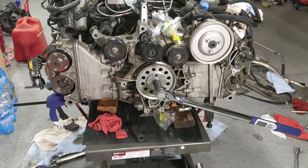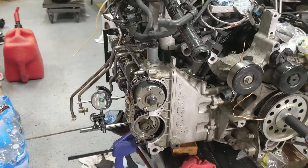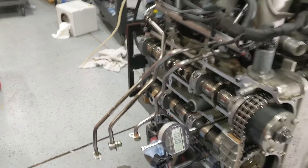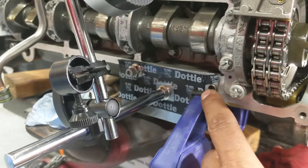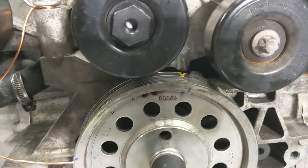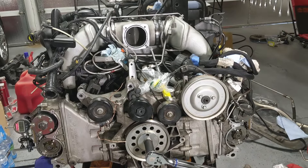Just a quick follow-up video. I used the dial gauge and found true top dead center on bank one — it came out the same as bank two. I'm going to remove the dial gauge now. I made a little apparatus to hold the dial gauge in place with one bolt holding it to the valve cover attachment point, using a makeshift C-clamp to hold it down. The timing notch is essentially three degrees off from that notch. When I timed it the first time, I was four degrees off of bank two and 6.67 degrees on bank one.